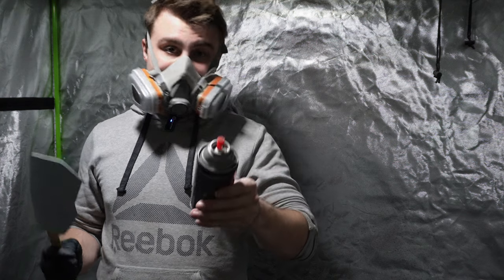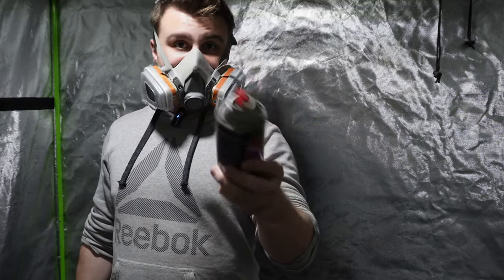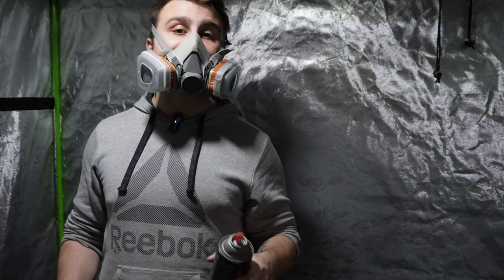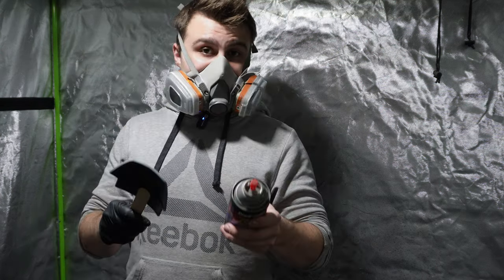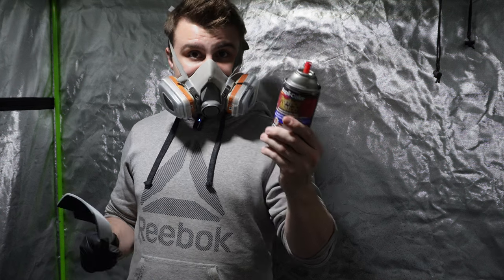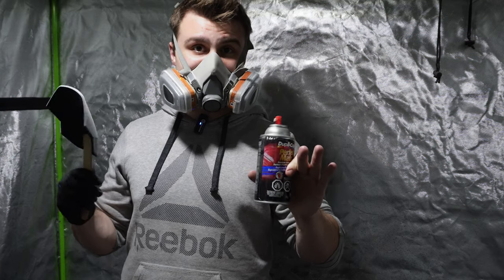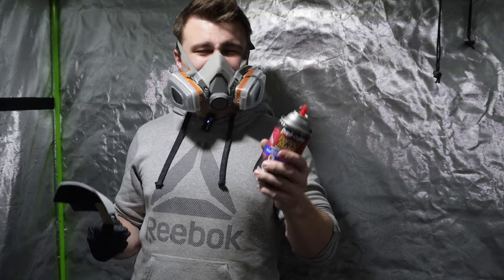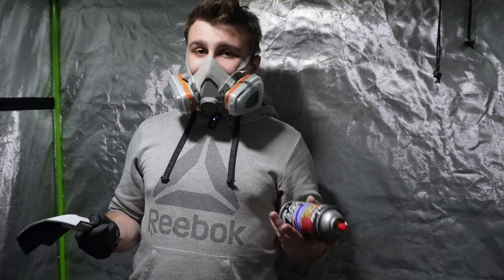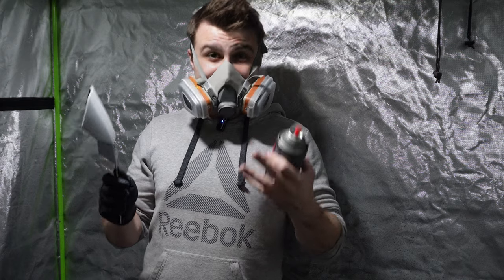Before I do any painting with rattle cans I always re-read the instructions on the can, because not all paints are made the same. With Duplicolor Perfect Match paints, they recommend shaking the can for one full minute before using it, then 10 seconds for each minute of use. They also recommend two to three light coats to prevent sagging. I've used this paint before and found it always takes at least three coats to be properly applied - anything under three coats doesn't have the exact color it should. So if you have to apply more than one coat, it is what it is - at least you're not ruining your paint job with sagging and running paint.